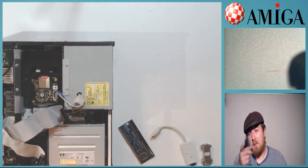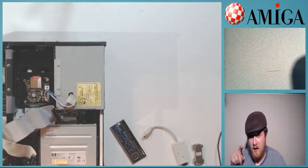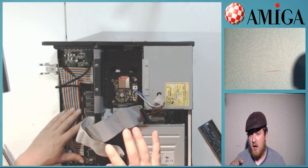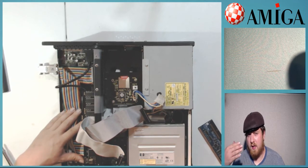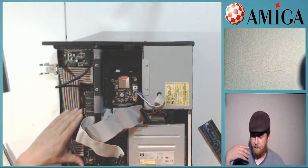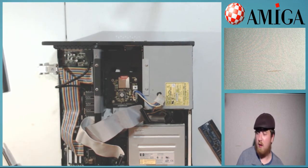There is a Big RAM Plus for 2000s. However, you have to have the 030 accelerator, and that particular Big RAM attaches onto the expansion slot on the accelerator card itself, and that is only a 128 megabyte expansion. I have a buddy of mine, Carl, that has one. He loves it.